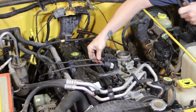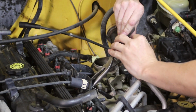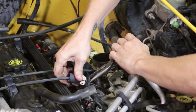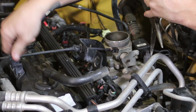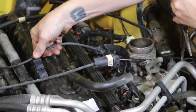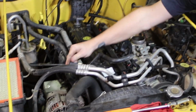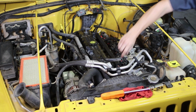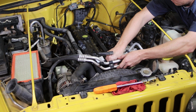We have cleaned the engine some already. With these valve covers, you want to look at the leak. They tend to leak at the back first, and a lot of people think, oh, my rear main seal's gone. Well, you want to check the back of the valve cover first. They start at the back and then those leaks move forward. So if you're leaking at the front, you're probably leaking all the way through the front and back. So we're going to get started on that.